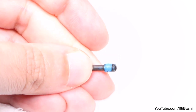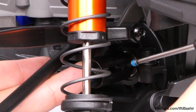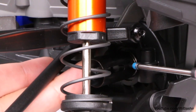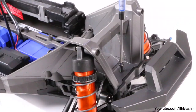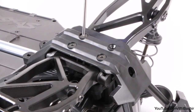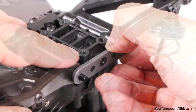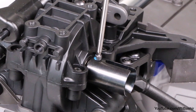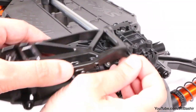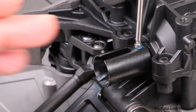Be sure to use the new screw pins supplied with the CV shafts — the new pins already have a patch of blue thread-locking compound on them to prevent loosening. However, I found it far too tight to get the pin into place, so I decided to release the lower suspension arms. That meant all 8 screws to remove the centre skid plate, the one bumper screw between the shock tower up top, and the 4 screws beneath the front skid plate to remove the bumper and gain access to the suspension hinge screw, which can be removed to release the lower suspension arm. With that out of the way, installation of the CV driveshaft is super simple. We'll go ahead and remove the opposite side too, and insert the new cup here as well, so it's ready for the dog bone and axle, securing tightly into place.